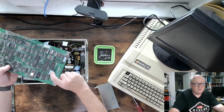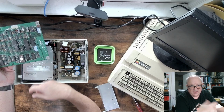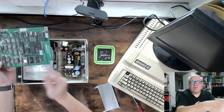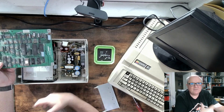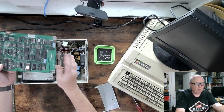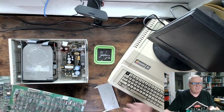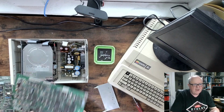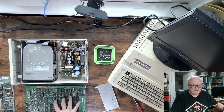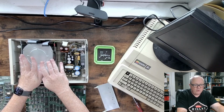These switches are actually used to tell the motherboard the geometry of the hard drive. Sort of like in original PC-AT BIOS setup, you had to tell the BIOS of the PC, is this a type 1 drive, type 3 drive, etc. You do that by switches here. So I would set all of the boards to the same switches so that it knew how to work for this drive, boot it up with the Apple, and could I access it, knowing I had one working machine. Having done that, I found all 4 boards I had worked. At least it appeared they all 4 worked with this drive.